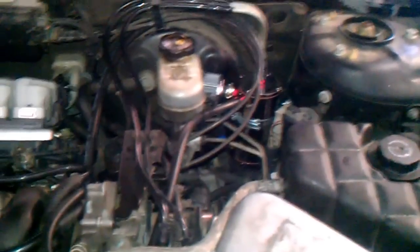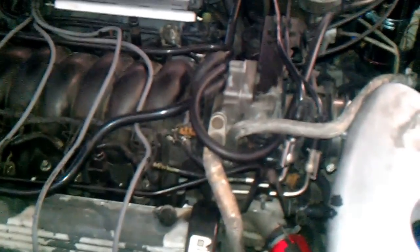One way to kind of keep at high RPMs from smoking a little bit. A lot of Mustangs do it, a lot of the higher RPM engines. This one being a built North Star motor — it's 477 at the flywheel. When it hits 7 grand, it smoked a little bit. So this is going to alleviate that problem and let the motor run a lot cleaner. It may possibly last a lot longer.